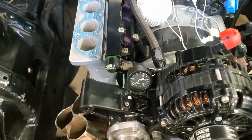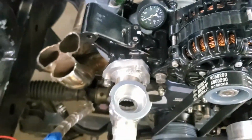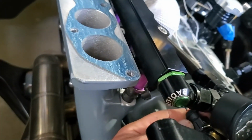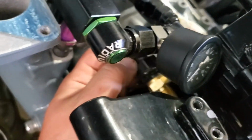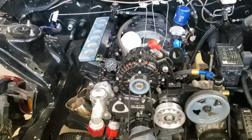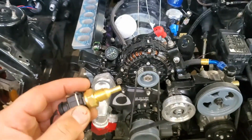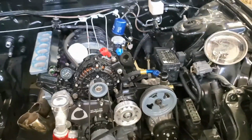If not, I was concerned that we wouldn't have enough room in the back here, because it goes right underneath the fuel stuff. But if I can unplug this real quick, so we can have full control of the moving sensor. So it has to go under there. If we bring it out, and if it doesn't hit it, then it's fine. And it won't really get in the way of the injectors if we have an adapter. So we might have to do something. I was thinking a brass elbow, because he said this should be 1/4 inch national pipe thread, where this one is an 1/8. So we did an 1/8 thread in, like a street elbow, to maybe 1/4 inch. I don't know if they'll mess it up. I don't know. We'll see. We got to figure something out there.